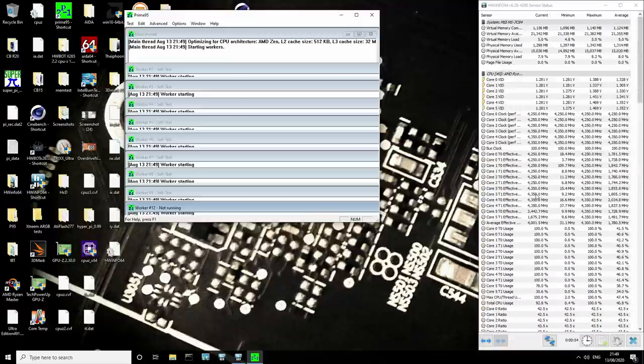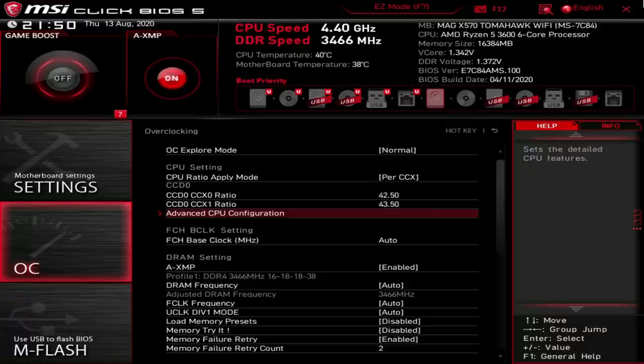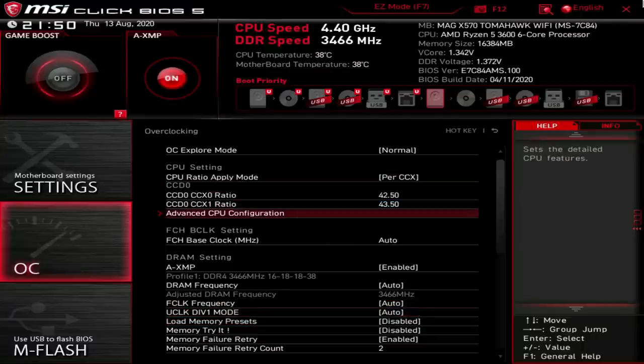which, oh, there goes the whole thing. Okay, so I could also bump up the voltage another. Well, actually, I can't. The chip is almost at 95 degrees, so again, if I had a better cooler, I would be willing to bump it up another 10 millivolts, but as it is, nope. The cooling's just not good enough, in my opinion.